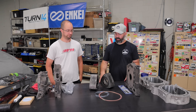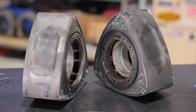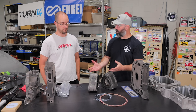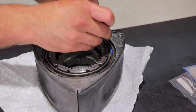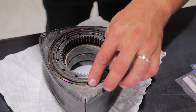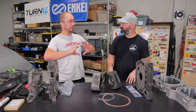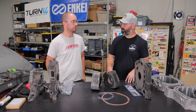As you would have seen in part two, Joe has already gone ahead and installed all the side seals, corner seals, and all that. So these are now fully assembled rotors. He's just installed these oil control rings, which is a pretty straightforward process. There's a dowel on the compression ring on the outside one, but the inner ones have springs with two tabs — one's a circle and one's a square — and you have to install them correctly because of the rotation. You don't want the rings to spin, so the spring actually holds those rings in place. They do have to be installed correctly.